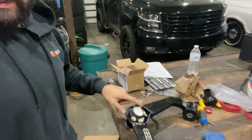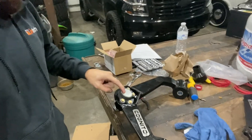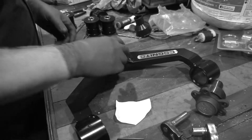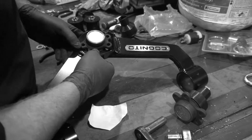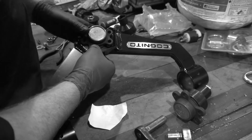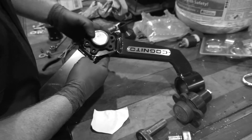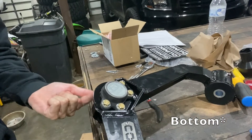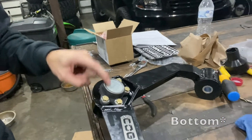24 hours later — all right, we are back the next day and we're gonna get this lift finished up. I want to show you guys: we actually put this in backwards. Make sure you put those bushings in the right way so you don't get roasted by the internet. The ball joint here should come up from the top as per the instructions, so don't do what we did — put it on the right way.